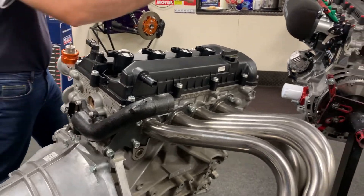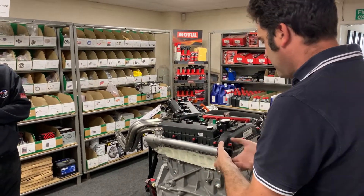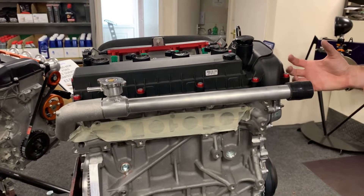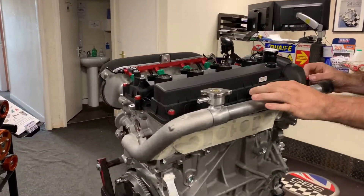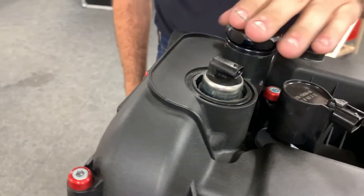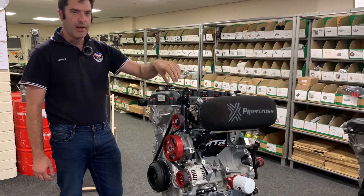We're running the standard elbow on the back of the engine — the Ranger spec one on the Ford engine. Then we have our water rail pipe that goes in — we've got this in a couple of variants. That one's got the filler cap on there and then it's straight out onto the rad with a little bracket on the front to support it with a nice rolled end. We can also do it without the filler cap on — for certain applications like some Escorts where the filler cap is already in the header tank on the radiator, you'd just fill it as you did on your older Pinto or crossflow application. We've also got finishing bits to make the bolt heads look nicer. Then we've got a new oil cap — the standard Ford one is quite high, but we can cut this down lower to give more bonnet clearance. We also blank off the original Ford breather and have a dash 10 fitting that goes onto the side of the cam cover, then a 90-degree fitting into your catch tank.